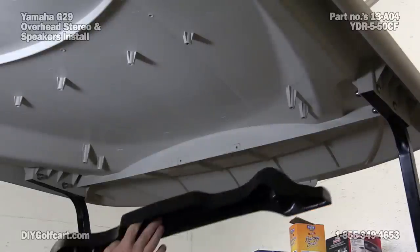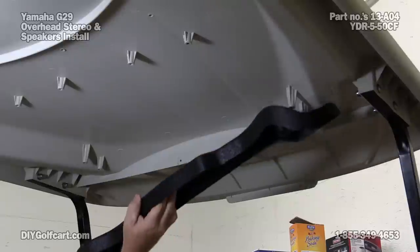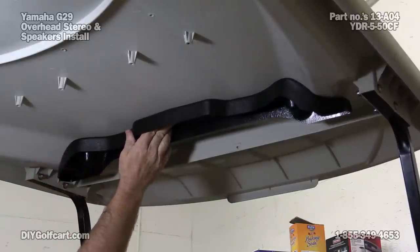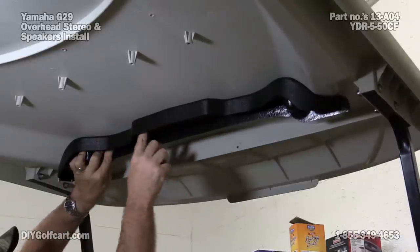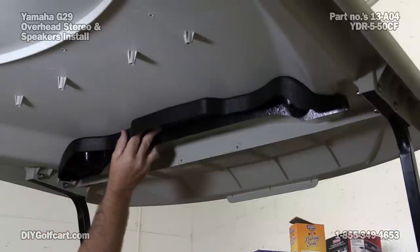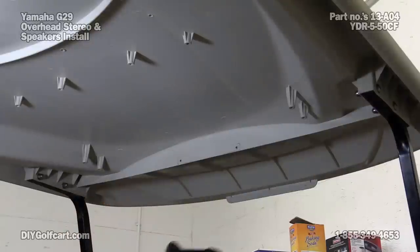Our bracing is going to be this piece that fits over the front two posts that stick down. It will go up like this. We have six pop rivets — two large ones that come down into the larger holes — then we have four other locations where we're going to have to actually drill through the roof. I don't like doing that, but once done, I'll put a little bit of clear caulk on it so nobody will see it, make it airtight. So let's go ahead and get this thing mounted and go get the pop rivet gun.